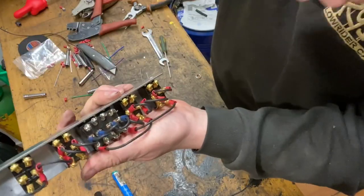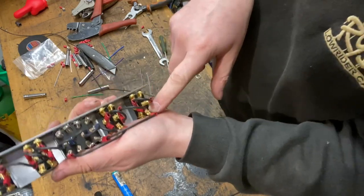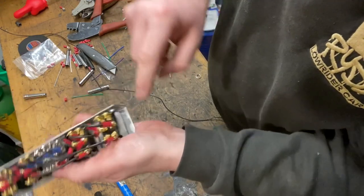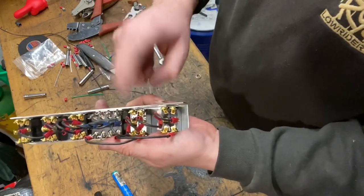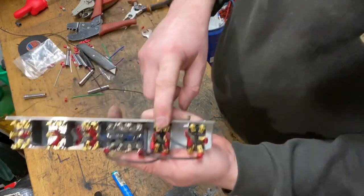So that's all the solenoid wiring done, apart from the main wire from the switch wire that goes to that first switch. So it's the same here. This is going to be a front switch. So you need your two front dumps, which on our list were grey and grey and black. And then on this switch, you need your two rear dumps, which are white and black.